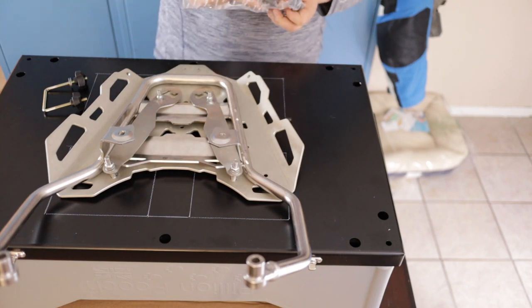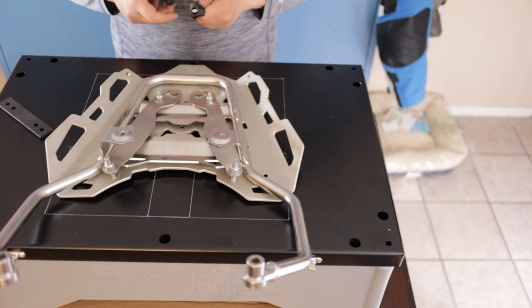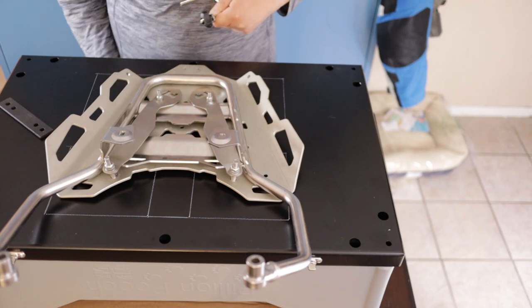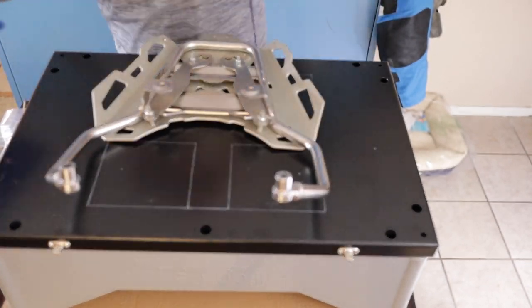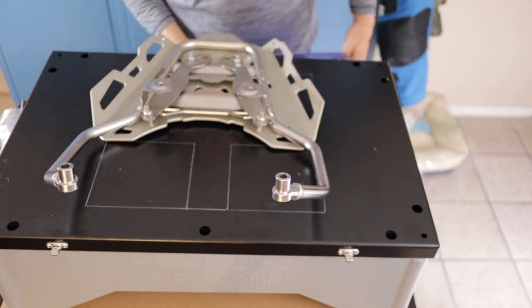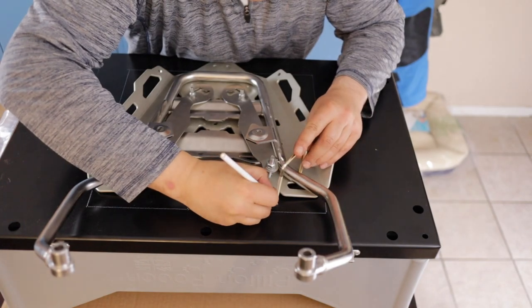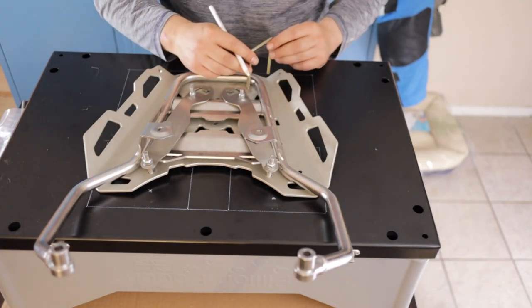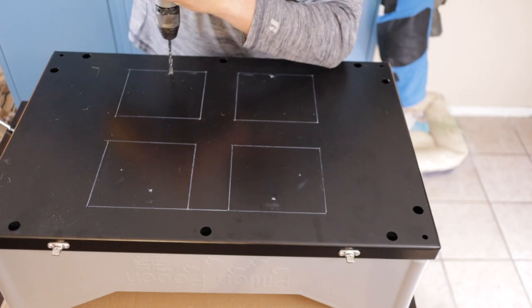You'll want to take your tail rack off the motorcycle to line up your mounting locations for the Pylon Pooch. Make sure you have the front of the Pylon Pooch — the part with the lower lip — facing forward, corresponding to the front of your tail rack. You'll want to make sure there's even spacing on each side to center on your tail rack. It's best to get a rough idea of how far forward or backward you want the Pylon Pooch to sit on your tail rack and mark it before taking the tail rack off the bike. I am mounting the Pylon Pooch on my stock BMW GSA tail rack with the Alt Rider plate.